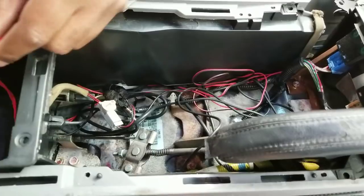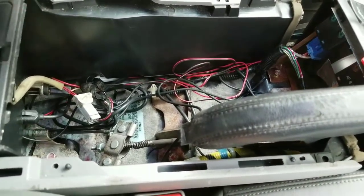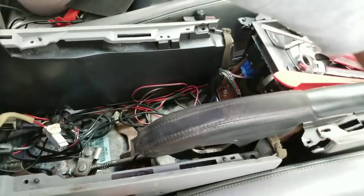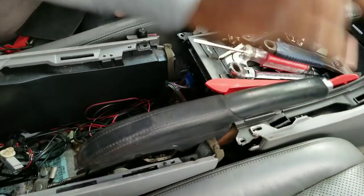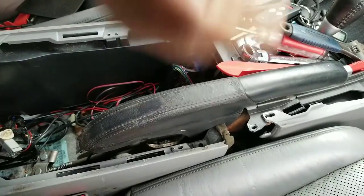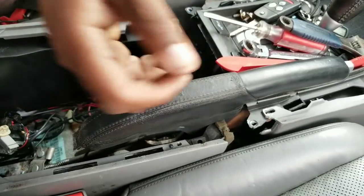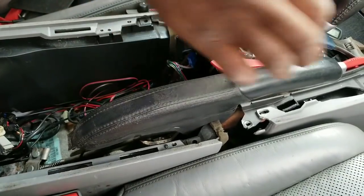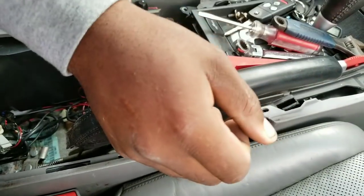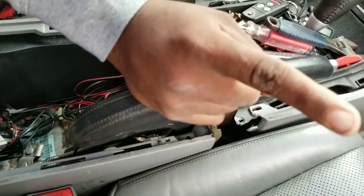When you drive, just make sure that you check it also when it's in the air. Release the e-brake and then spin the wheel to check and see if there's any drag on the wheel. If there is, then adjust it so you don't get any drag, but it locks the wheel in place when you adjust it, okay? Just keep that in mind.